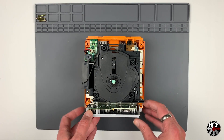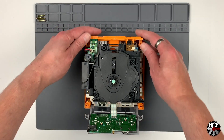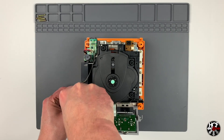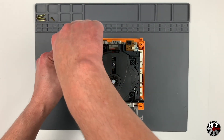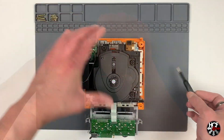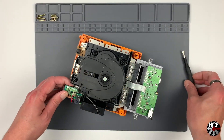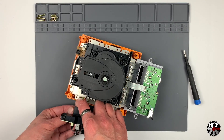All we need to do is pull on the little clips and the controller port assembly just pops off at the front. Then we do the same for the AV covers — that just pushes off easily, held on by a couple of clips. Next, grab the number two Phillips screwdriver and work through the screws starting on the fan assembly side. When you remove the fan and power button assembly, you'll find the hidden screws underneath.